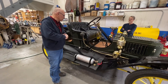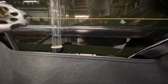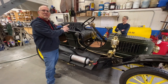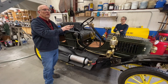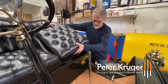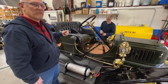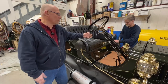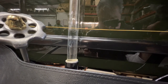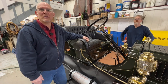In the morning when you're first starting out with the car and it's cold, the first thing you want to do is check to see that you have water in the water tank. There's a copper water tank underneath the front seat in this car — it holds about 25 gallons and that's what feeds water to the boiler. The access for the tank is under the seat; when you lift the cushion there's a lid on the tank and you can put a hose in to fill it. It has an overflow so it won't overflow all over the cockpit.